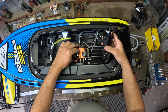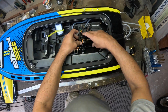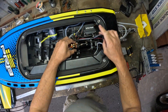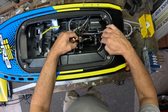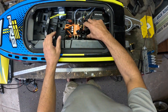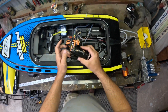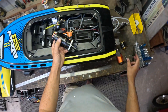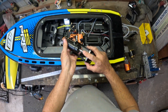So the length of this motor is a limiting factor because I don't want people to have to move the speed controller. This motor is 107mm long, and that is the maximum you can fit in there — she only just fits. I may even have to make a small adjustment on the motor mount to slide it forward. I really wanted to put a 4090 in here, which is another 20mm longer and would be way more powerful, but it's just not going to fit.